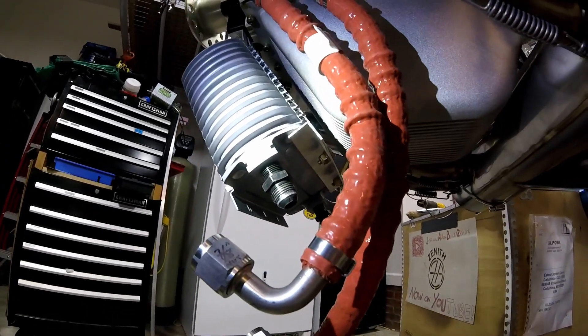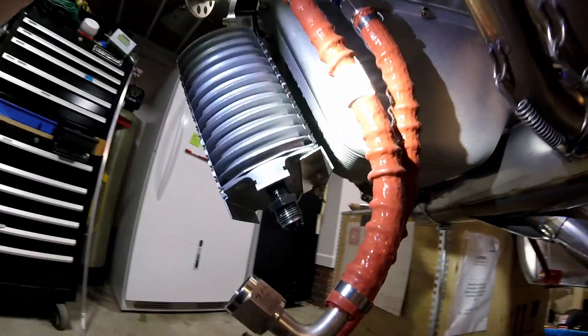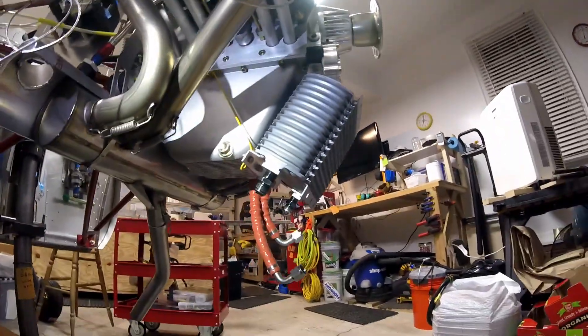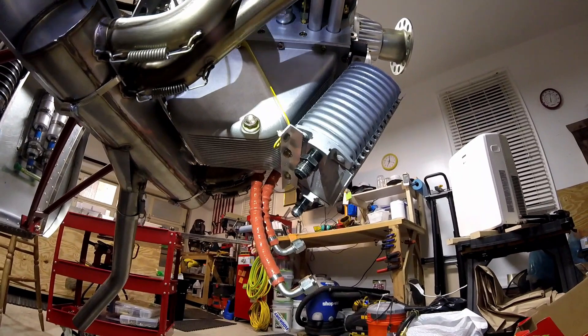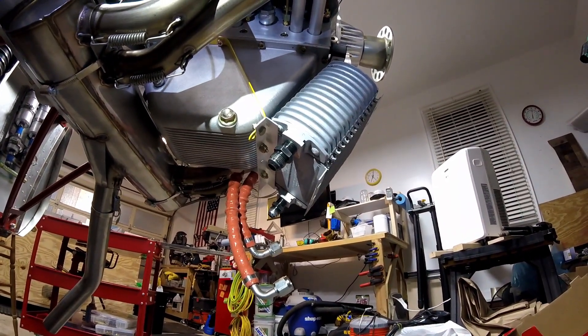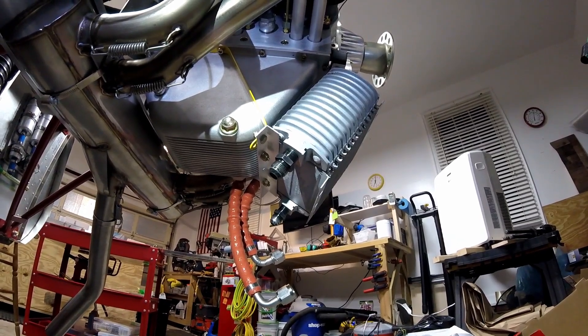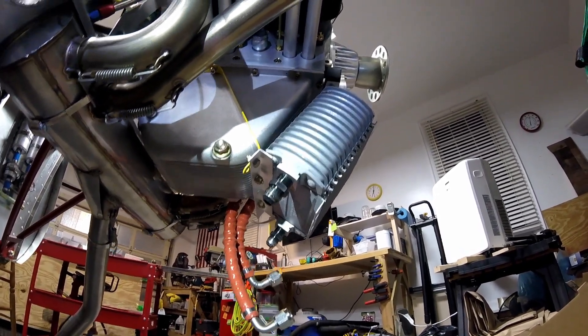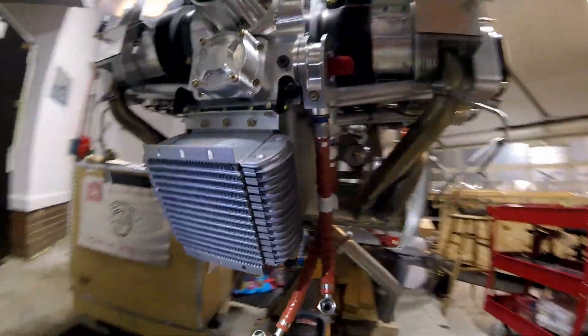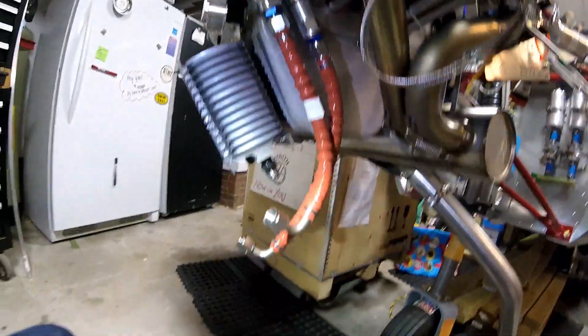These fittings were difficult to track down but I got them. These are steel fittings from Aircraft Spruce. I got steel fittings because I read on the oil cooler supplier's website that you really want steel, because aluminum tends to get screwed up, and if it screws up the threads on your oil cooler you're done — you really can't re-thread it.